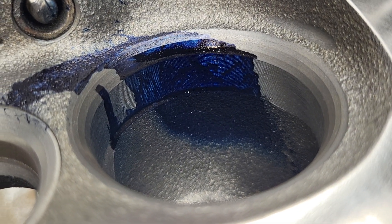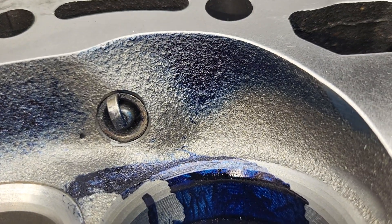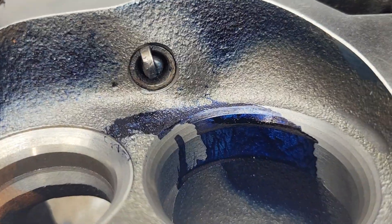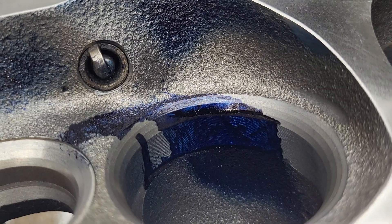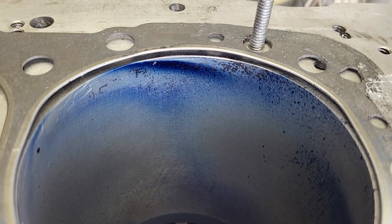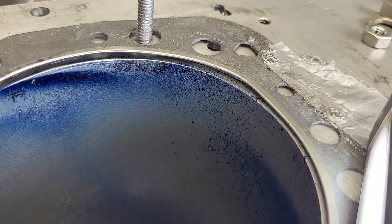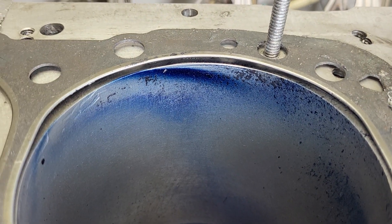Overall, not bad. It goes across the plug — we got some on the chamber there, we got some all the way on the exhaust side. Really, really not bad for completely stock. It looks like you can see what it's doing — it hit that side and then splattered over to the other side. We can work on that; that'll get better as we do it.